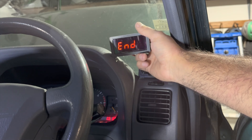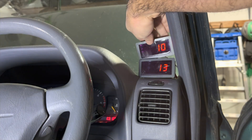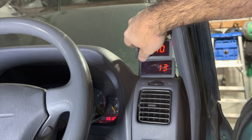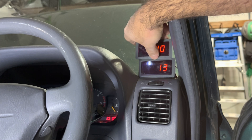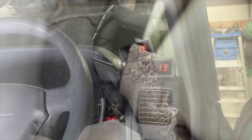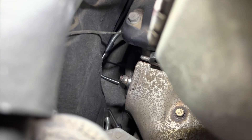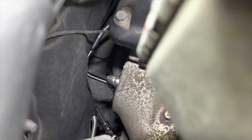And end. Set. All right, so now we got them both. This top one is in the manifold and the EGR block-off plate, and this one's in the downpipe. In this garage it's about 14 degrees Celsius. So this shows you got the one in the downpipe at the bottom, and then the other EGT probe is in the EGR block-off plate right at the top on the manifold right there.